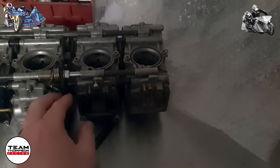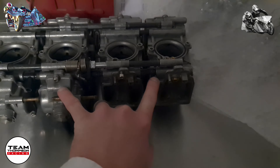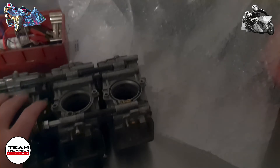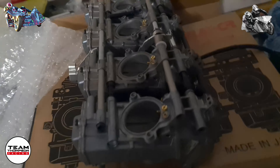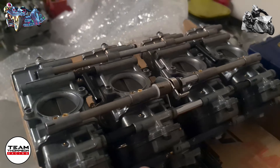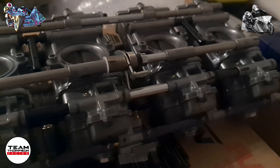You'll notice this T-piece here — it's in this section and it's actually for the return line. These two are the inlets — fuel to all four carbies — and there's the return line. That's how we maintain a particular pressure and flow. You'll see that one's got a cap on it, not too sure why they did that.